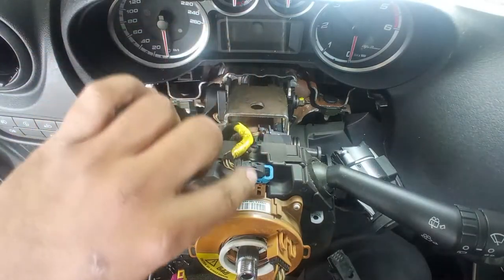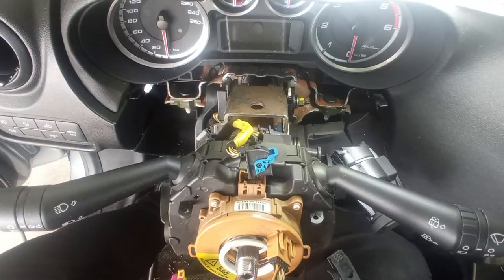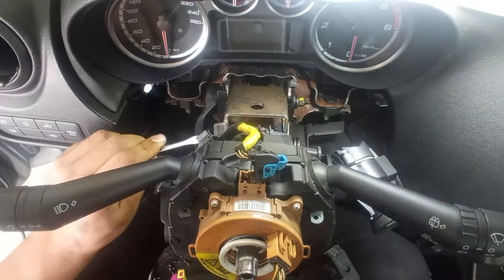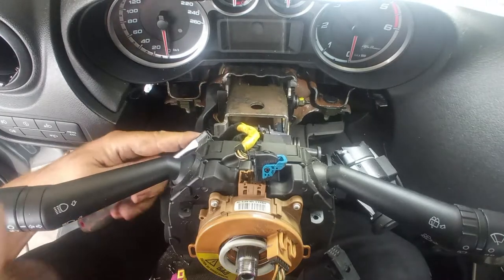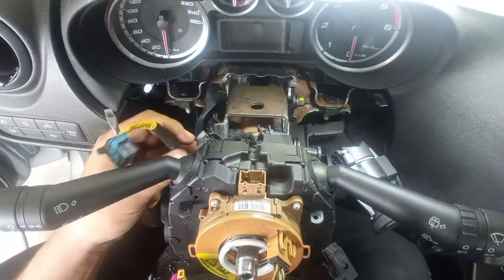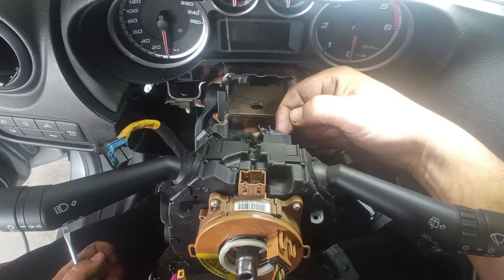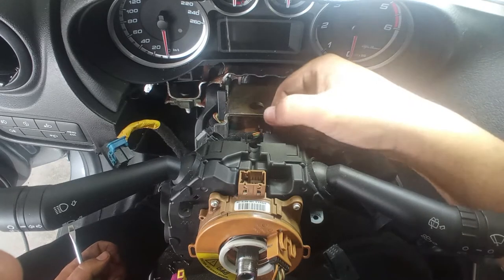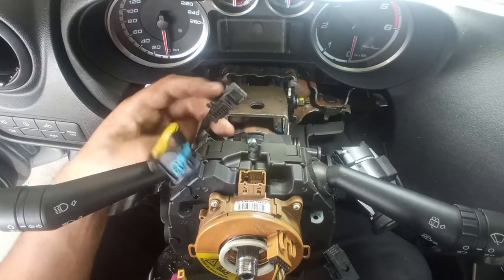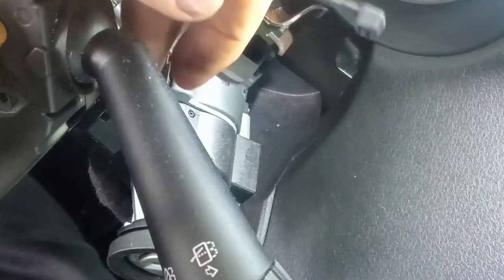For being so small, this connector is a little fragile. The original alarm system wires have to be reached here because of the blinkers, and sometimes they break. Now taking out the wiring clip — I have another one on the back here — press with my thumbnail and then with a finger press it down and out. Now I have the two pieces of wiring out. Down here there is a zip tie around the ignition barrel to prevent the wiring from scuffing.